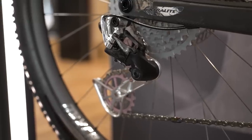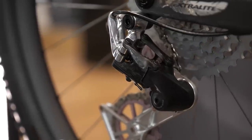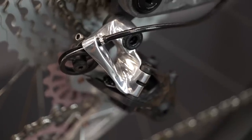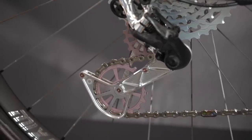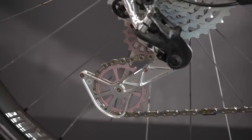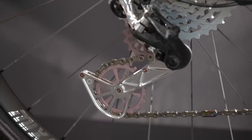The rear mech is actually one of my favourite parts on this bike. I went with a mechanical on this one because it's lightweight, but also I just love the proportions of the mechanical derailleur. It has a custom polished B-knuckle — the rearmost part of the derailleur — then the middle section, the parallelogram, is carbon fibre from Hop Carbon. Even the pins holding it together are carbon fibre. Then there's a custom Kogel Colossus oversized cage, which saves a bit of friction when the chain goes through. The pink pulley wheels are Cerakote, a ceramic-based paint — durable and very different-looking from anodising, so it gives a cool look.